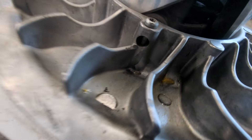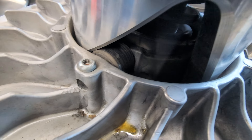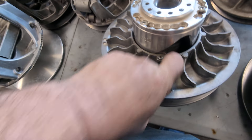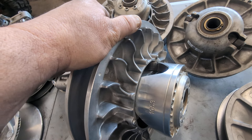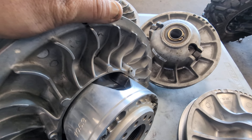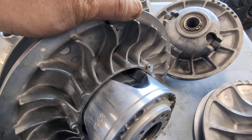This clutch right here — see how that roller is white? This has Extreme Rollers in it. This goes on my buddy Jake's drag machine. That's really the only failure I see in the Can-Am secondary. These rollers failing is super common. If you have OEM rollers in your Can-Am, hit me up here at HayterMaker Performance. Replace them before they break and ruin your riding trip.